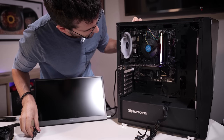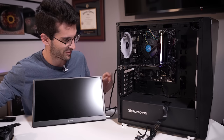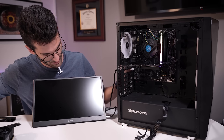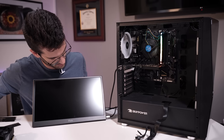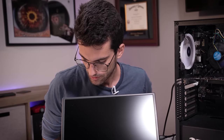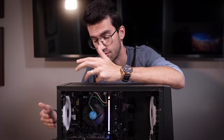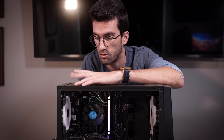Power is on pretty quickly. HDMI is connected to our swapped-in graphics card. It isn't looking too good. I was really hoping that bent pin would be the solution to our problems. Let's try swapping the CPU out — I don't think the CPU is the problem, I think it's the motherboard, but we'll swap it out to be on the safe side. The system hasn't reset itself since we fixed that bent pin, so we may have more than one issue on our hands.